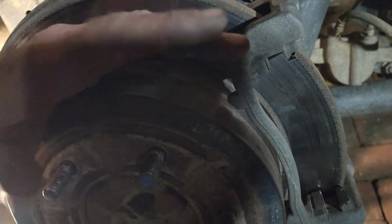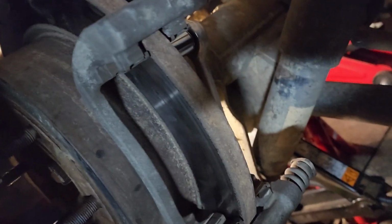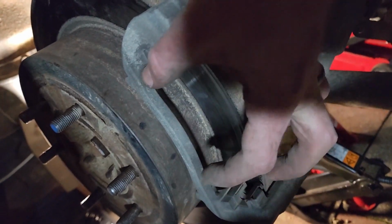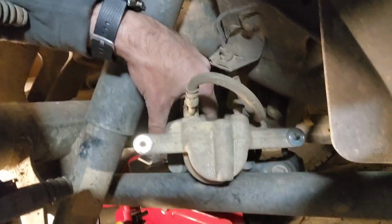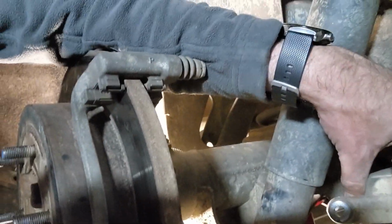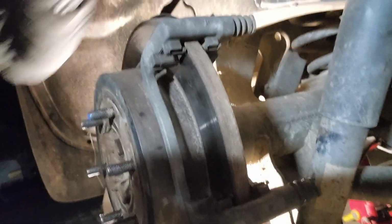the handbrake shoes. So now I'm just putting it all back together. I've put this thing back on. I'm busy with the bolts over here. Then I'm going to put the floating caliper back on over here. Checking just now. Before we put the caliper on, we've got to put the disc pads back on. Let me get this in here quickly. Make sure that doesn't fall.